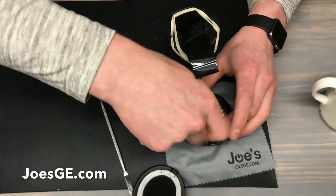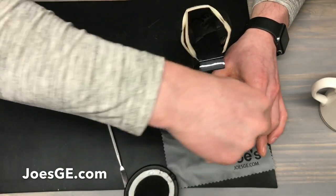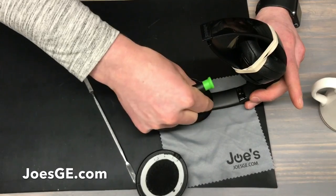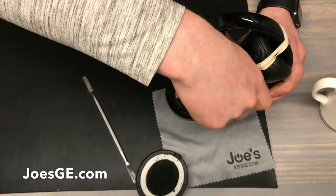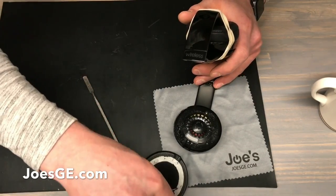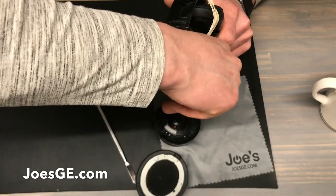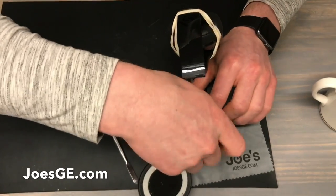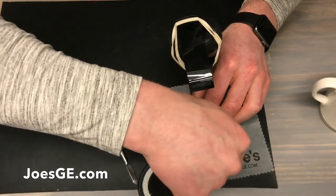Getting our first and last screws in — put the five screws back in place. You don't have to take the two smaller screws out unless you're changing the charge port; it just holds it in place. Make sure you put them in the correct spot and keep them away from the speaker. You don't want them going into the speaker housing — if the screws go into the speaker housing, it will damage the driver and you'll have to replace the new speaker you just got.